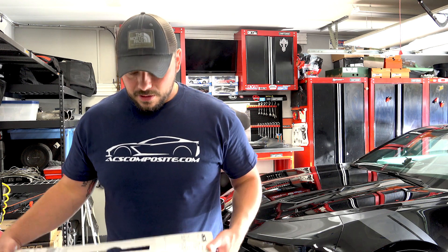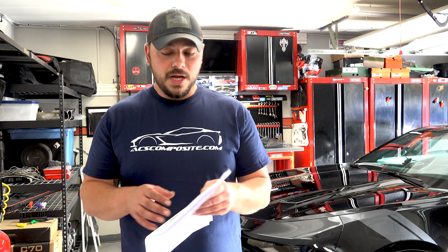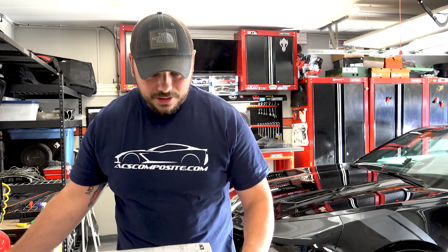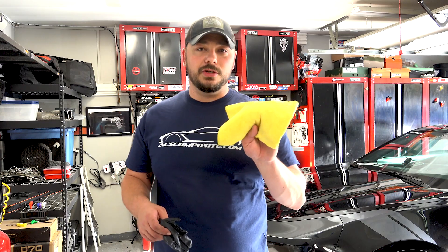So let's take a look at what comes in the box. It does include detailed instructions. I already opened this box to do a test fit, just to make sure I can supply you guys with the best possible install video. This is a fairly simple install — you'll just need a couple of tools, which include a drill with a 3/16th bit and a rivet gun. I would suggest taking the opportunity to go ahead and clean your front fascia, just because that's where we're going to be doing the work.